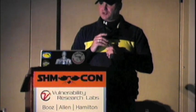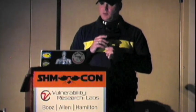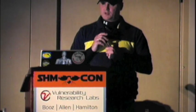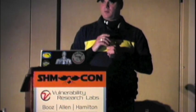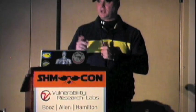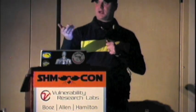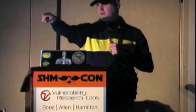But there are some issues with regards to motherboards. Like Intel motherboards freeze the command so that the command can't run correctly. And so you have to do like this cold boot trick in order to get around them. Send me a more specific email or something. But they do work, and I do have a previous talk about those. I did Shmoocon last year, top 10 things about hard drives, and I did it on that. Yeah. Yes, sir. Next. Right in front.